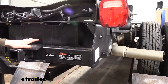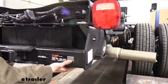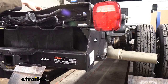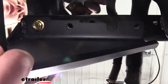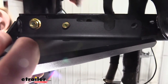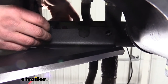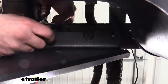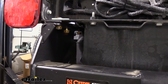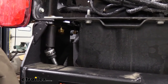We've gone ahead and drilled out all those holes and put our hitch back up with just the rear bolts in them again. This time we left it loose so we can move our hitch around as needed to get the rest of our hardware to line up. We'll now take the bolts we've prepared and drop them down through the top of the frame into our hitch — it may be necessary to wiggle the hitch around a little bit to get them to drop through. Place a flange nut on each bolt, then move on to the next, repeating the process until all hardware is installed. We can then tighten down all of our hardware using a 22-millimeter socket. If you don't have swivels and extensions, you may need to use a wrench in some of those locations.